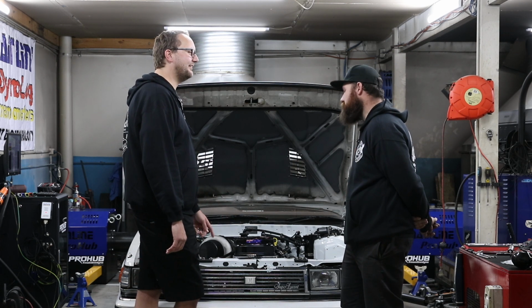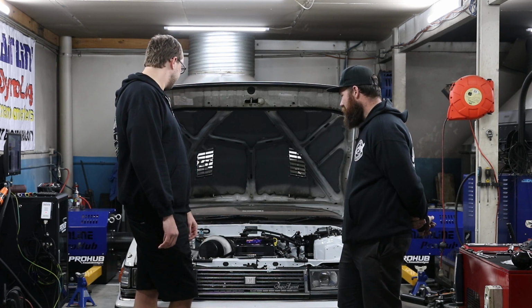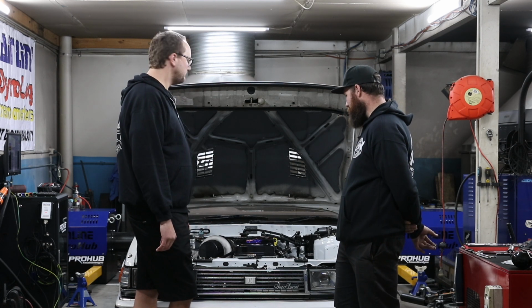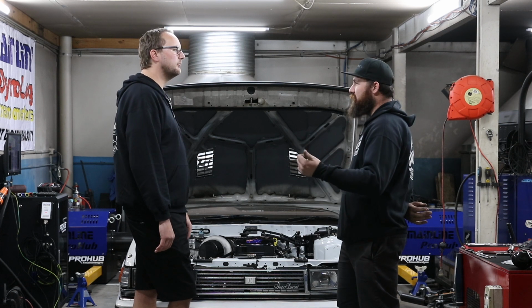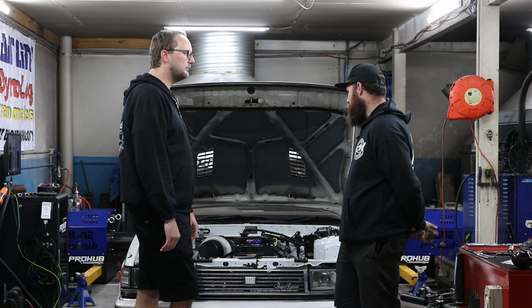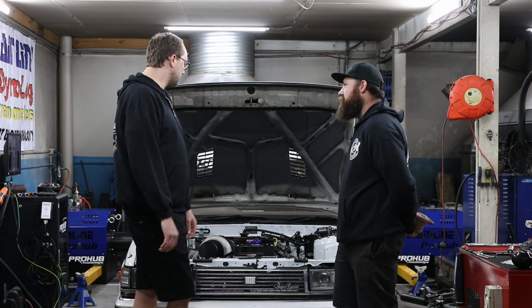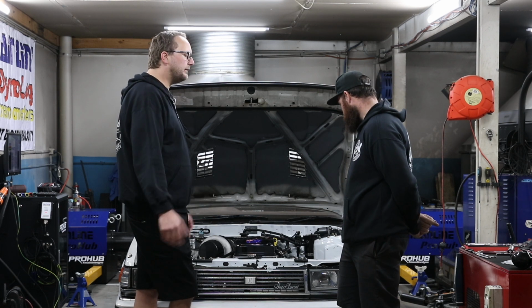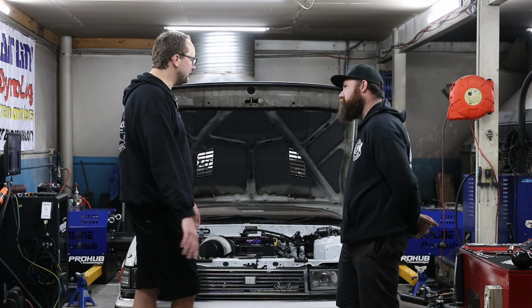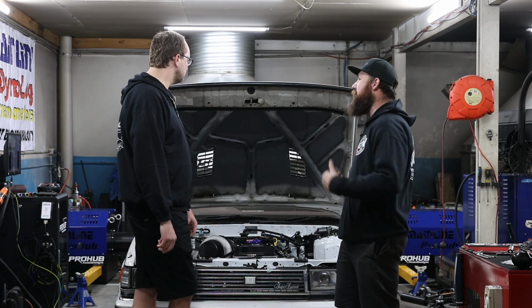Mate, the turbocharger, 42. Yeah, I'm converted. I was a little bit worried I might have gone a bit large on some of the housing choices and stuff, but it comes up nice and easy on the converter. Like at 4,100 RPM, it's making 12 pound of boost, and as you saw, it's just happy. At the moment, there's nothing really going on. We're kind of stopping because it's making good numbers. That's just where we want to be. We haven't really found the limit of anything. That's just where we're happy to run the car at.